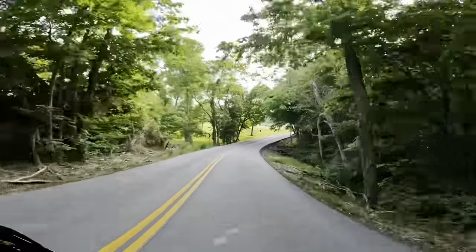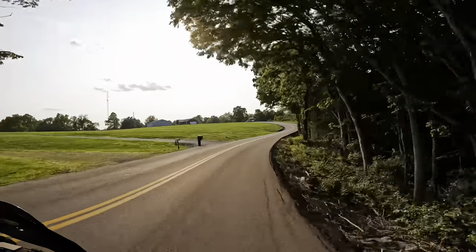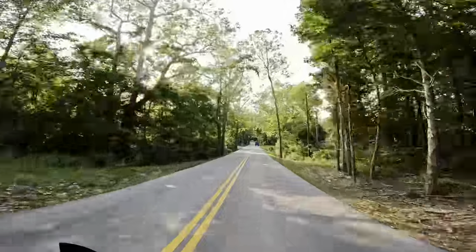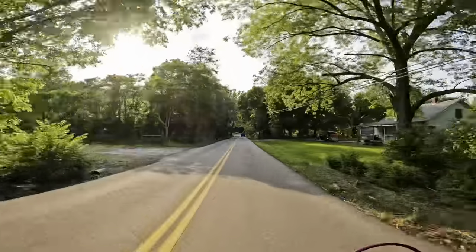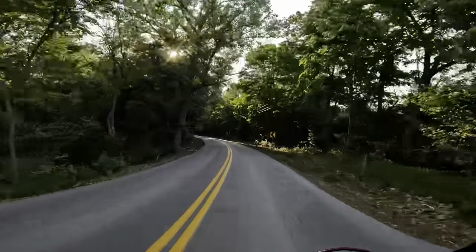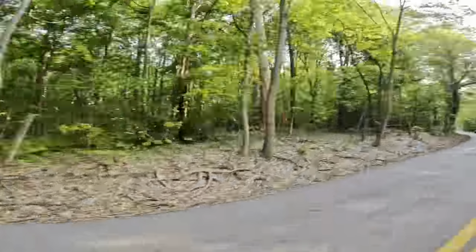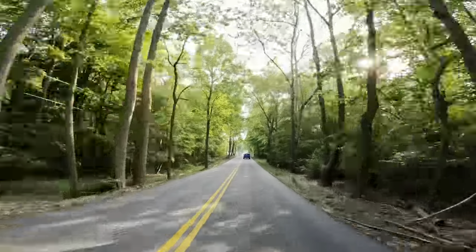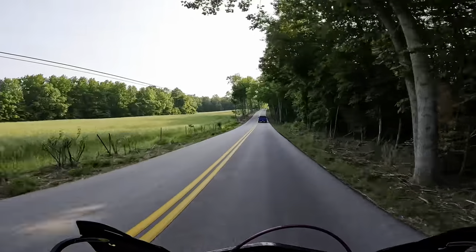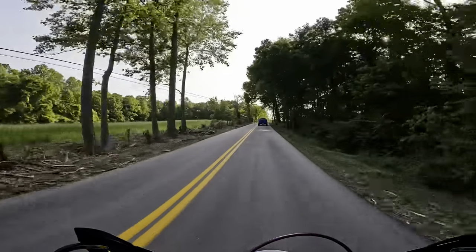It handles like a dream in stock form. The Dunlops that come on — I think they're like Dunlop 207s — they're not the greatest tires in the world, but they get the job done. This is an excellent commuter bike. It's nimble, you can flick it around, and it gets really good miles per gallon. Even if you're really hard on it doing wheelies all the time, in stock form without being jetted you still get 60 miles a gallon or better. I did a three-by-three and a JD jet kit right out of the gate at maybe 400 miles, plus an exhaust — I did all three mods at once.